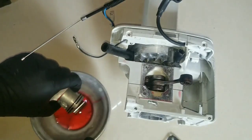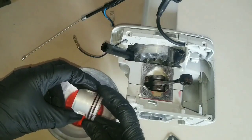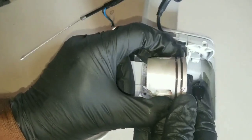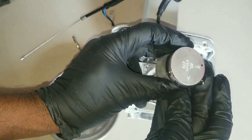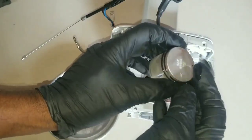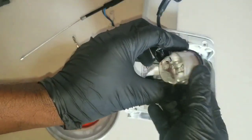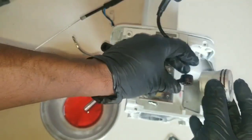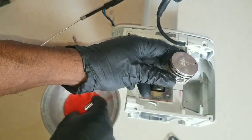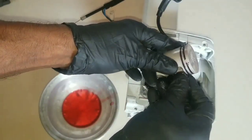Now we're going to get ready to install the piston, and we want to set the ring, like we said, where the dowel pin is. So the piston will be installed like this, where the two dowel pins are facing the intake side. That will be this side. So this piston will be going on like this, and then we have to get the wrist pin into it.